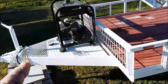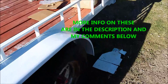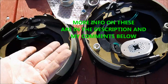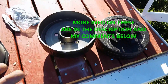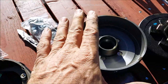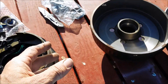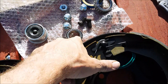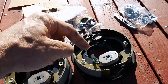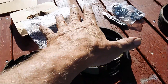That's going to be the next job, along with getting the generator doghouse put on and mounted. This whole 3,500 axle conversion kit is under $150 — pretty cheap and comes with all the hardware. They say it fits any 3,500 axle, but that's not entirely true — know your math, know your bearings, know your oil seal, and compare that to the specs. Check the link in the description — there's detailed information there to help you match what you're using.